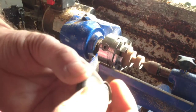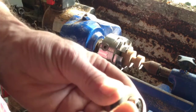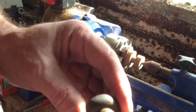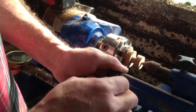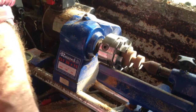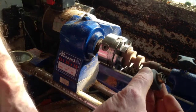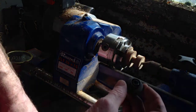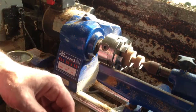I'm going to make the shank of this new knob a bit thicker than this because it's got a metal ferrule on this one. Usually when I make a thing like this, I like to get the metal ferrule off. But it's absolutely jammed on because I absolutely boiled the kettle dry and it got very hot. It's melted all the plastic inside. I'm pretty sure you can't see how badly melted it is, but it's bad. And it has gripped this ferrule on.